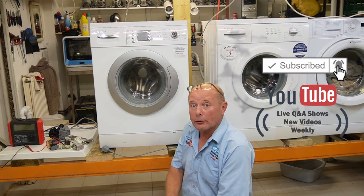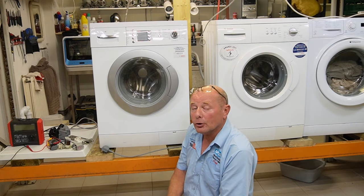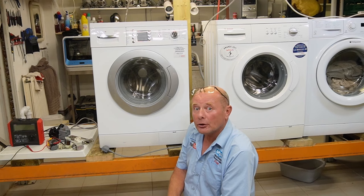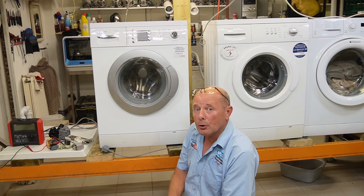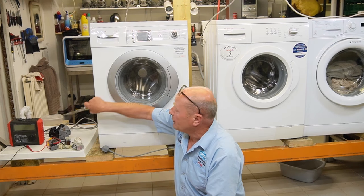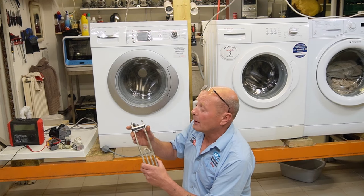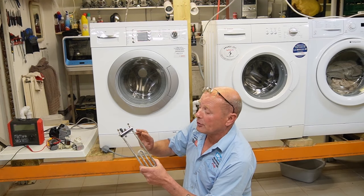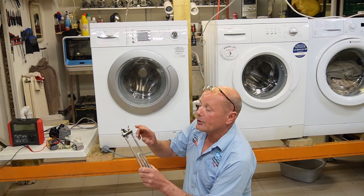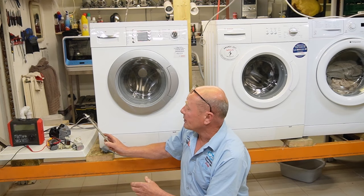In other words, knocking off the power for the house. There are two ways this can occur. One is with the RCD, which is a residual current device. This is designed to protect you from earth leakage on components. The most common component to fail on a washing machine is the heating element, because it is constructed of steel and connected to the chassis via an earth cable.